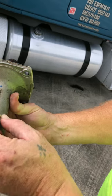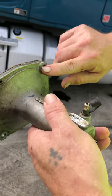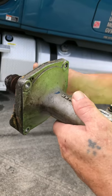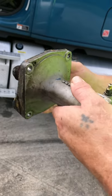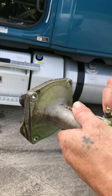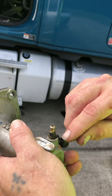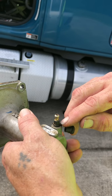When you go to bleed this, what I did was I put the hydraulic line on there, broke this loose, and got it to gravity feed. It was doing that while I was putting these four bolts back in — you slide it in there and tighten those bolts up. Here's another trick: this is the bleeder screw — that's an eight millimeter wrench that you'll need on that.